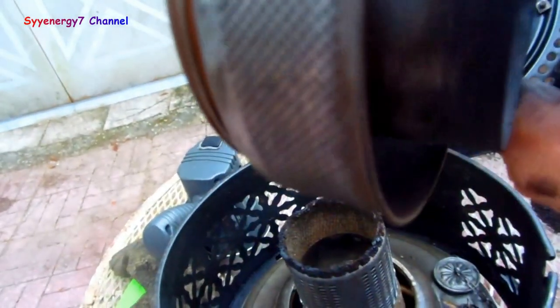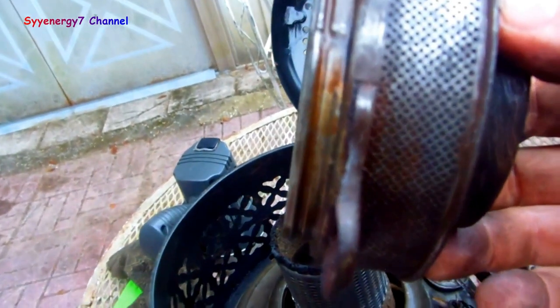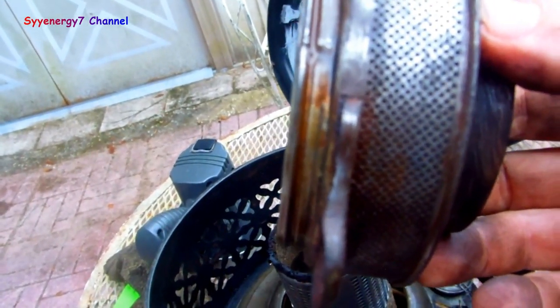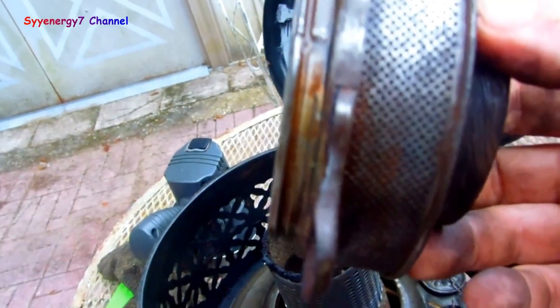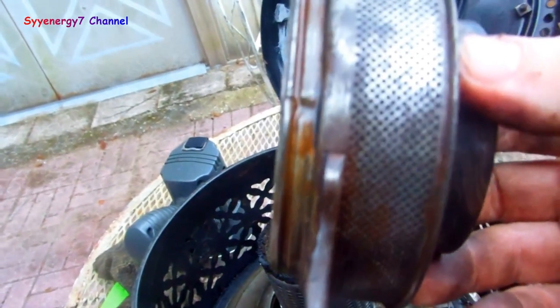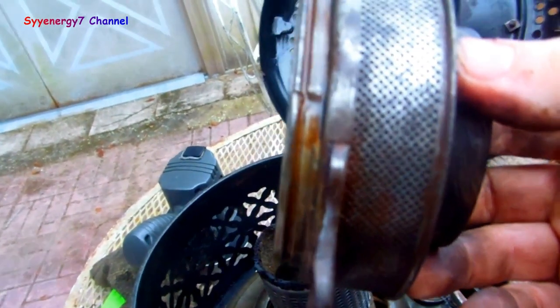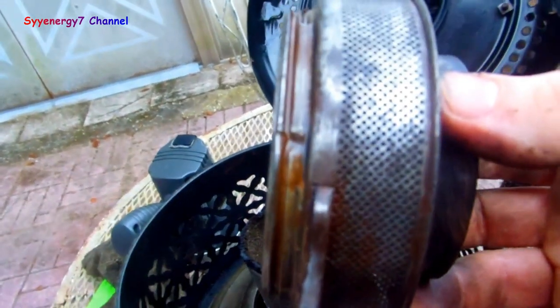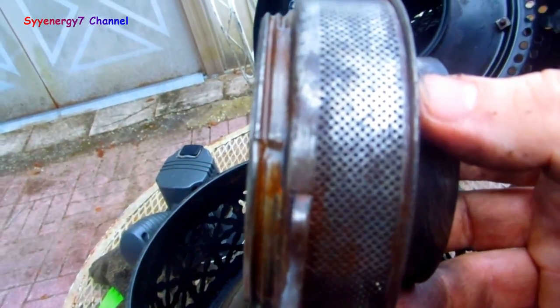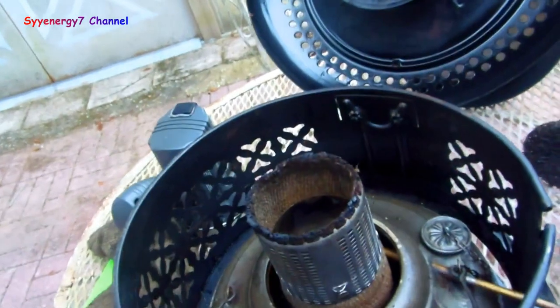The holes were staying clean even with the diesel fuel. The ultra low sulfur diesel - they actually call this a kerosene slash oil heater, which could use lamp oil, home heating oil, and a lot of other fuels. Kerosene probably works the best, but I have not had any problems with the BP ultra low sulfur diesel. I'm going to start throwing a little more kerosene in there because I've got no wick left at all.